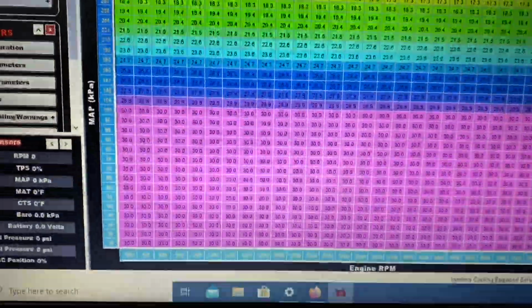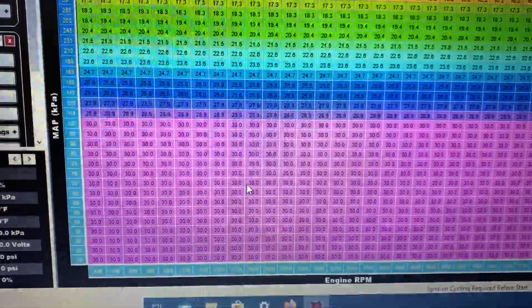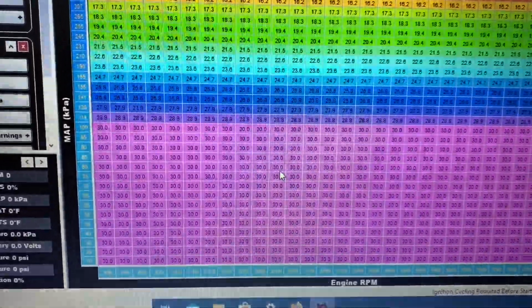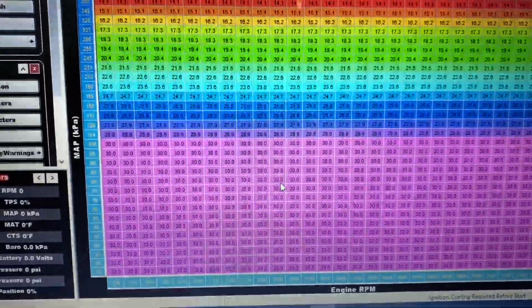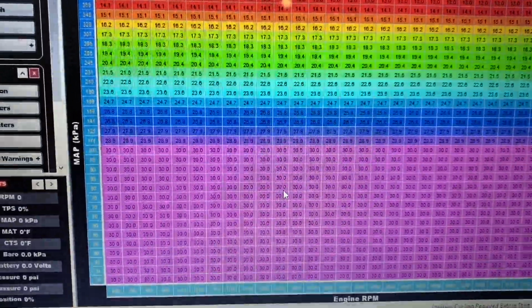On this instance, this is commanding 30 degrees, and if the balancer reads high, then it could actually have been 32. That's how you blow engines up, and that's how engines perform poorly if it goes the opposite way.